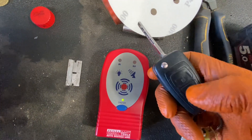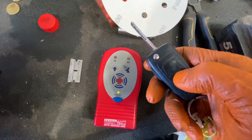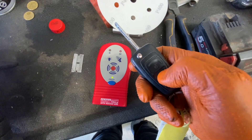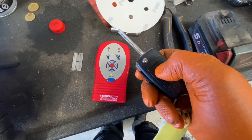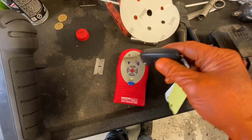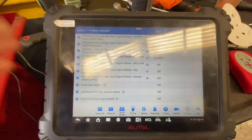Here is just a little infrared tester - when I press my buttons you can see there's a signal. Did you hear the lock stopped? I have a signal there - locking, unlock - but then nothing, nothing, nothing. I am getting a little light so the battery is probably strong enough to illuminate this, but once I've used the lock and unlock button a couple of times the battery in the key is going flat.